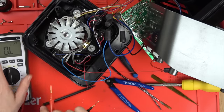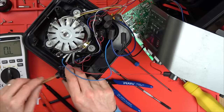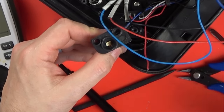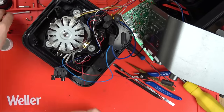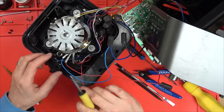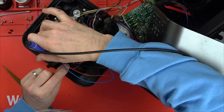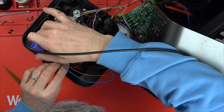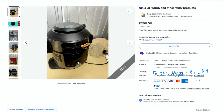I have a quick look at the little switch and I do see that there is some sort of liquid damage on it - it looks a little bit brown on the inside. So I need to solder it back on and I'll just use a little bit of isopropyl alcohol to give it a clean. Then we can put this back together and we'll see if it's going to work. This whole thing looks immaculate - it looks like it's had very little use. We found the problem and it makes sense: if the micro switch isn't detecting that something's on the top, it's not going to work because it's a safety feature.